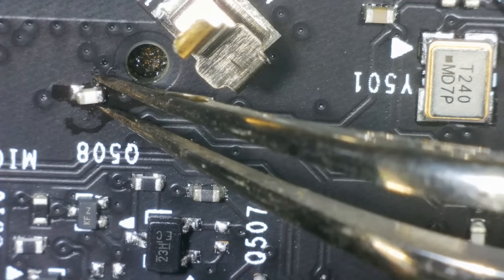Well, its reading is open. There's no resistance between it. Should there be? I don't know. Right, we've got another cap shorting here. And it goes straight into this chip. So all of this rail here is shorted to ground, and I'm not sure it's supposed to be. All the way up to this inductor, whatever it is, and right the way through it. So it's possible it's the chip or this capacitor, or it could be neither. But considering I'm not getting anywhere, let's take the capacitor off first.